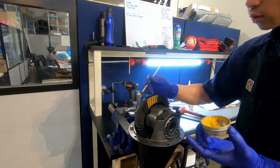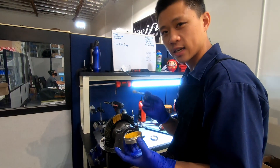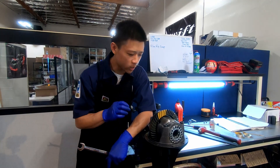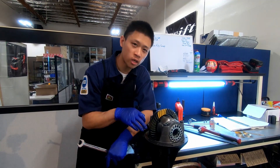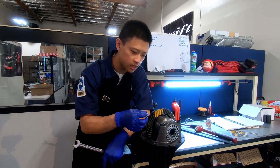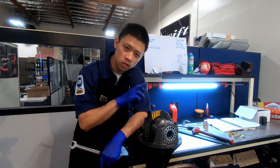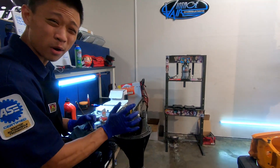There are four or five teeth here, so I'll show you how I check gear contact pattern. Here's the important part: if you just roll this around, that's not going to be accurate. What you actually want to do is simulate the load of the vehicle on this ring and pinion, because once this is loaded up in a car the gear contact pattern is going to crawl up. So it's important to be as accurate as possible — just rolling it around will not give you an accurate pattern.